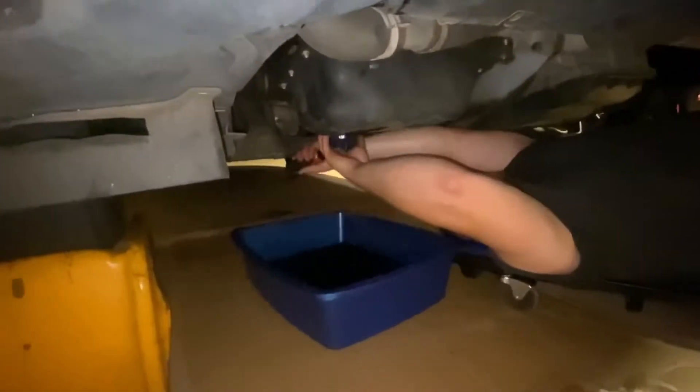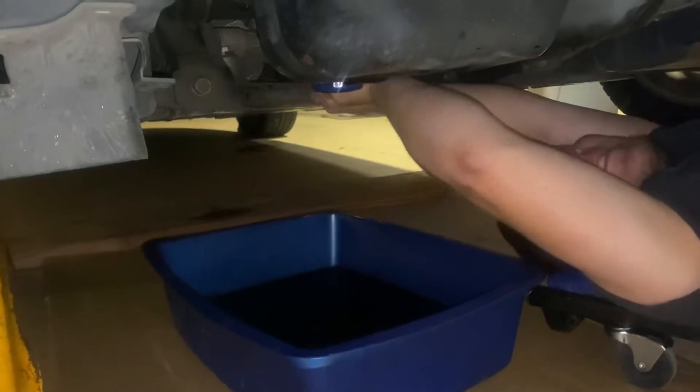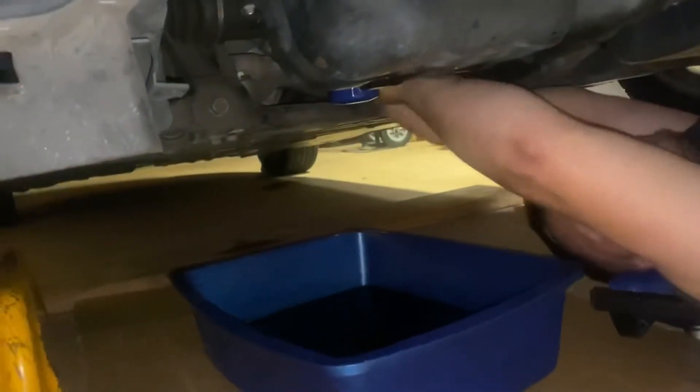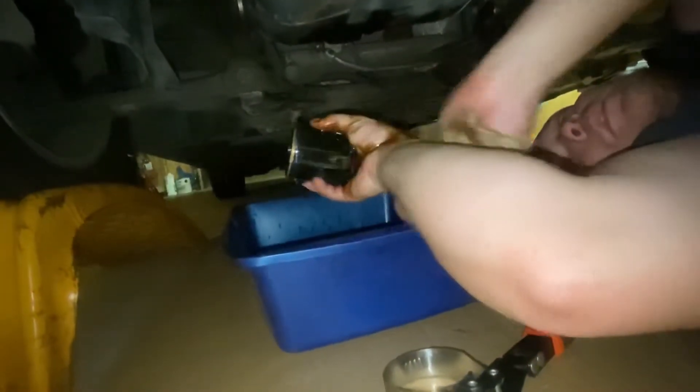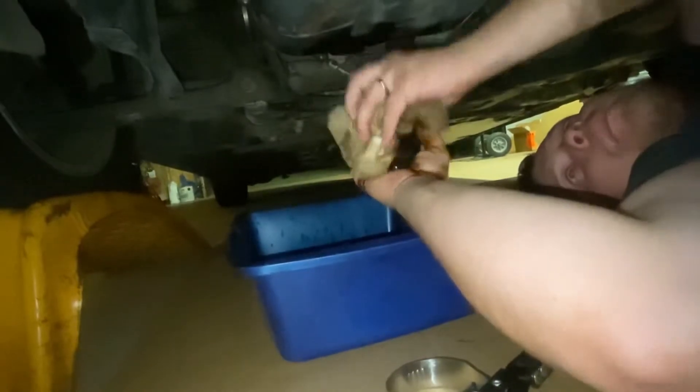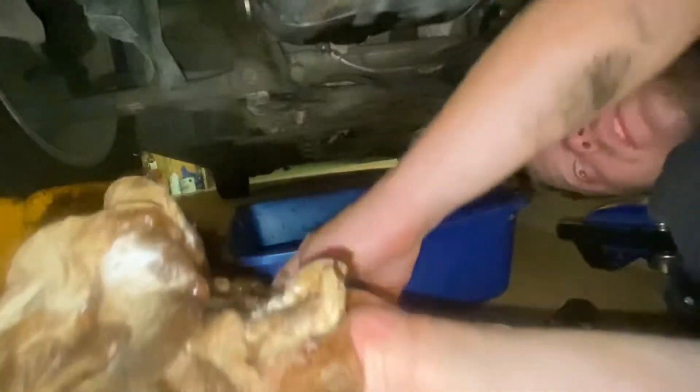Now I'm going to get the oil filter wrench. I always forget which one to use when I do my own oil changes, but since it's going to be easier to reach I might be able to use this small one. Counterclockwise, pull and take it off — it's spinning because when I put on my own oil filters I don't over-tighten them so I can easily take them off. Once you do that you might be able to take it off by hand. Make sure the oil filter is positioned over the drain pan because your hands are going to get dirty. You could wear gloves, but I'm just a little lazy today.